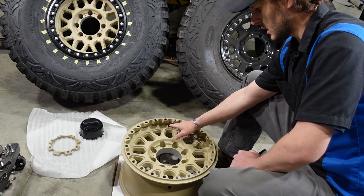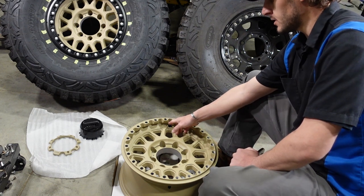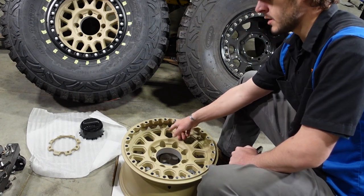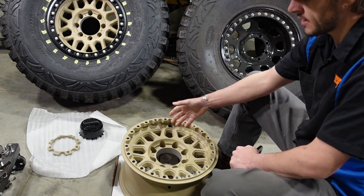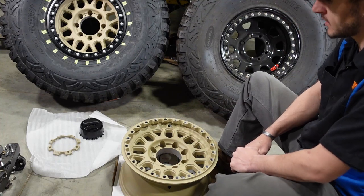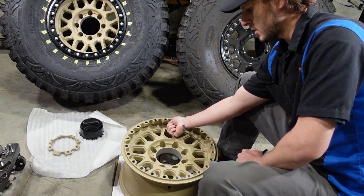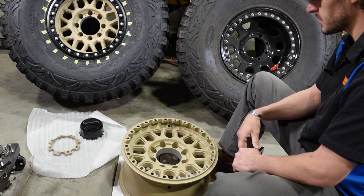It makes me nervous because you can't install or remove these without taking the tire off. The point of running bolt-in stems is that if I put my air chuck on here and walk away, the weight of that air chuck is not going to torque on it like it would on a rubber one and break that rubber valve stem. So these should be stronger for that — because if you're airing down frequently enough to need two valve stems, you're not going to want to hold the air chuck on a 40-inch tire by hand. I just clamp a chuck over the valve stems, turn it on, and walk away. That puts a lot of stress on rubber valve stems and I've had it break them off.